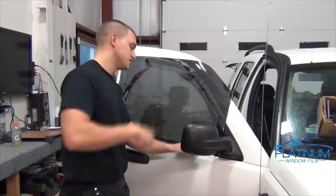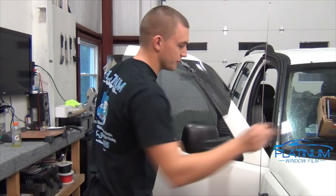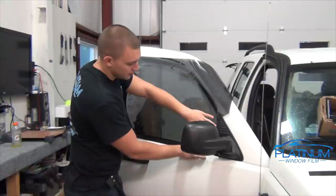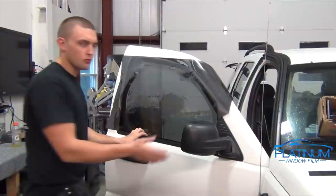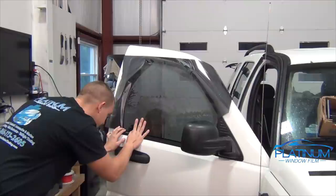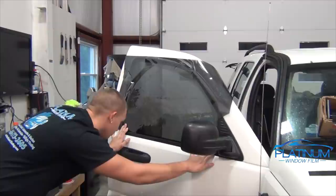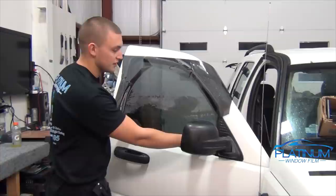The first thing you're going to want to do is cut the front edge. Always rip the tint away from the film so you don't tear into the film. Once you cut that front edge, lift the front edge up and slide it over the plastic where the mirror molding is about a quarter inch to a half an inch — about a quarter inch is enough. Once that's overlapped about a quarter inch, you want to leave a hairline gap across the bottom. This will give you room to shrink out the fingers in the window film, allowing the water to dissipate through the bottom.